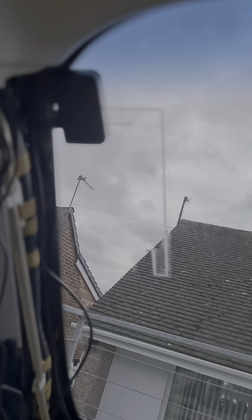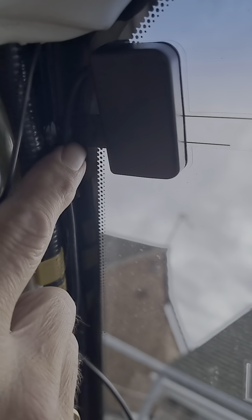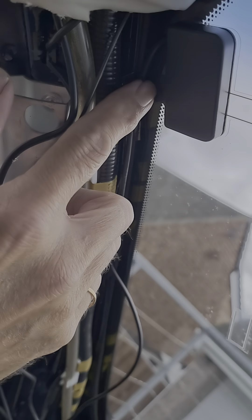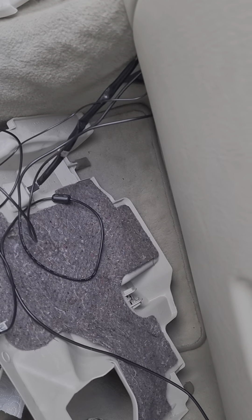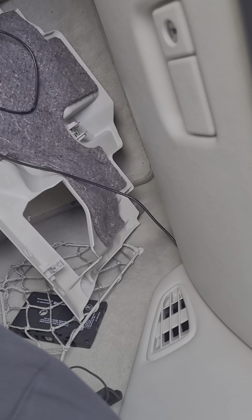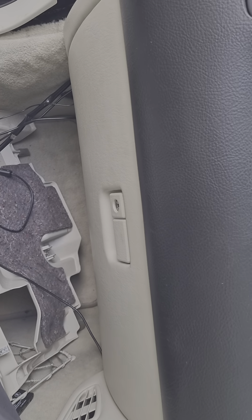So that's the microphone. Over here's the DAB radio I've put in. All you've got to do with this is quite simple — just make sure the glass is clean, stick it on the glass, and then there's a tail here. This tail needs to touch the chassis; it's a bit difficult to see with the light but it's touching the chassis there. And then that cable comes down the same way, run it underneath the glove compartment and into the back of here ready for the head unit. So that's how to put the microphone in and the DAB radio aerial.